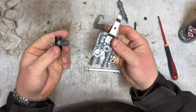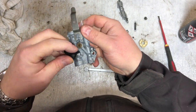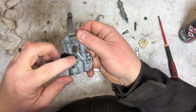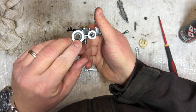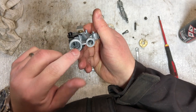Then we need to put this one in to open and close for the fuel to flow, and it has to be mounted like this. There is a little pointer here — it has to be in between these two legs so it can move. Here it will be fully open, as you can see it's open through, and here it will be closed so there'll be very limited fuel going through.